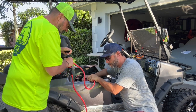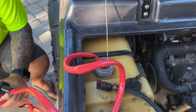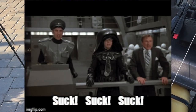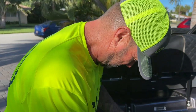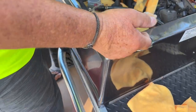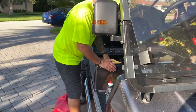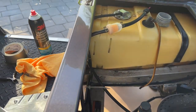Good news, guys. We were able to drain the entire fuel tank and we got all of the sediment and all of the crap out of the bottom of the tank. Joe used the siphon and we used that as a vacuum cleaner to actually get all of the crap out. There are like two or three little pieces of plastic in there — one is the hole saw cut-out from when I installed the gas gauge, another is a piece of a broken seal from the gas cap probably years and years ago. Joe's doing a great job with cleanup on the tank, and then we're going to start doing the fuel system — get the filters changed and the fuel lines.